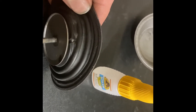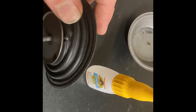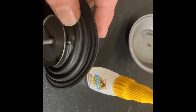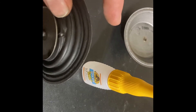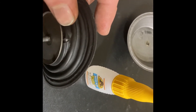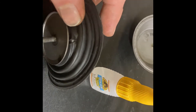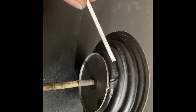Make sure it's dry. I recommend this super glue because it has a brush. What you want to do is get the bare minimum on there to glue it back together — don't coat the whole area with it, because super glue is hard and won't flex like rubber. So you want to get as little as possible to hold the split together.